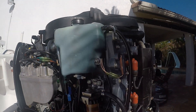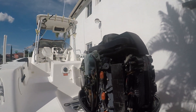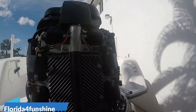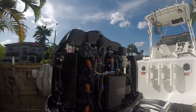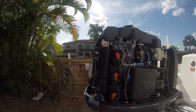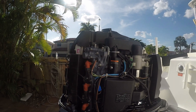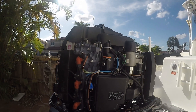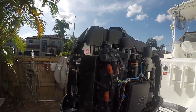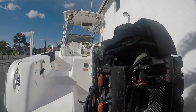That's a little tour of the engine. Now I want to talk about starting up this engine, because a lot of people have had issues and I couldn't find answers on forums. Specifically, what cylinders are running and which are not — because if you do a cylinder or spark plug test at idle in neutral, you will notice two cylinders are not firing.